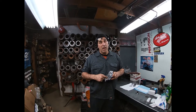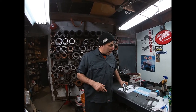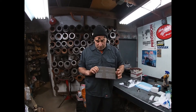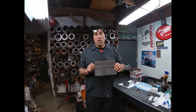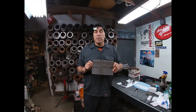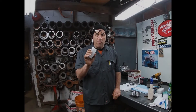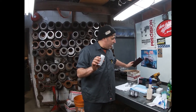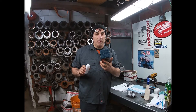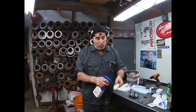We don't want to use a heavy-duty grade in here because what happens is it gets impregnated into the aluminum housing. Then when the hot transmission fluid hits it, it comes loose and aggressively eats up the rubber seal on the piston. So as you can see, what this says on it is 'ultra fine' — this is the gray color. The different colors of Scotch-Brite indicate the different coarseness or fineness: white being the softest ultra-fine polishing cloth, and then red and blue which can take paint off a car and cut your hands.